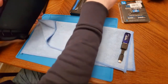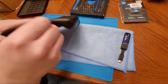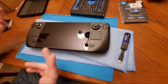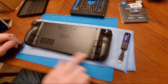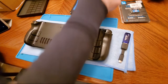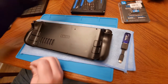I have trouble popping these things — just pop it right out. So the first thing we're going to do is take off the back. There are eight screws on the back and they're two different types — you can use the same screwdriver size, but the four outside screws are longer than the four inside screws. You have to be very careful because you can strip them.